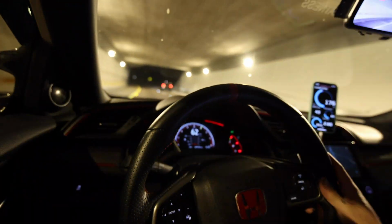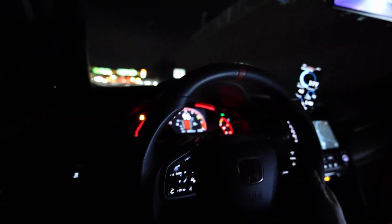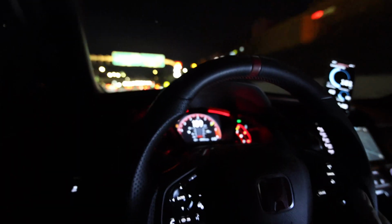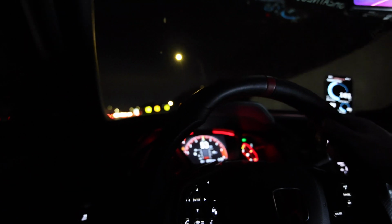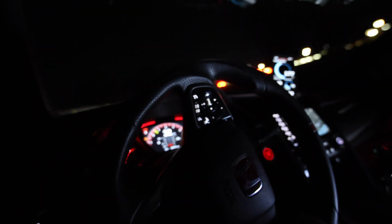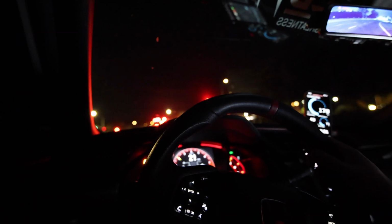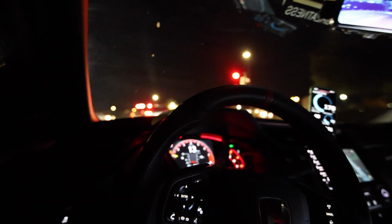Yep, definitely making boost. Yep, 28, 29. Yep, car seems to be performing like normal. Pretty excited. Now we're one step closer to getting back on the dyno over at Darden and seeing hopefully 550 horsepower out of this P600 turbo. But it seems to be running fine. I'm gonna drive it around for a bit more and see how it is and then check back in.